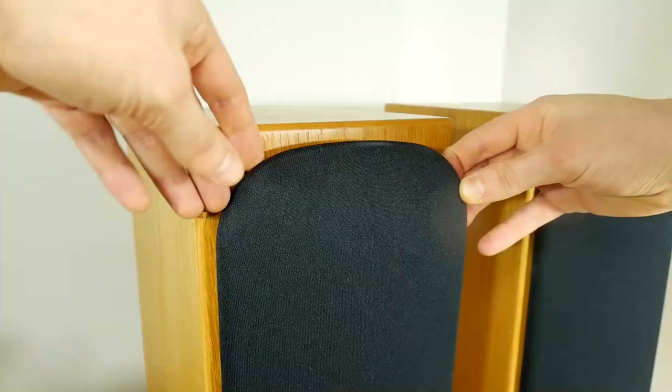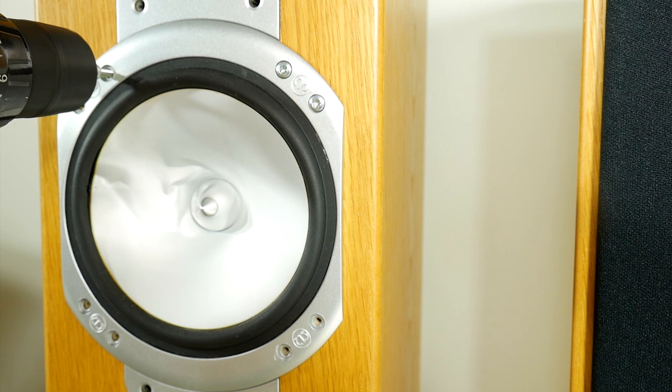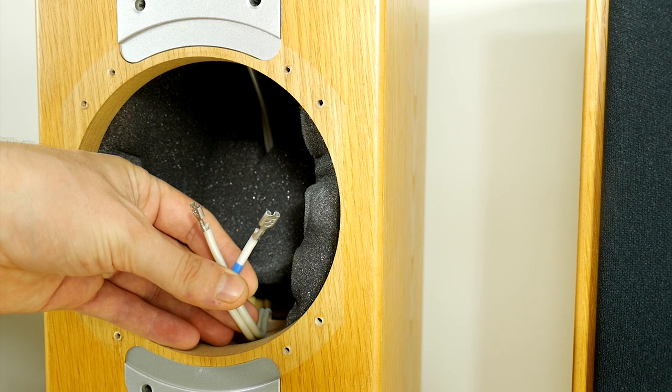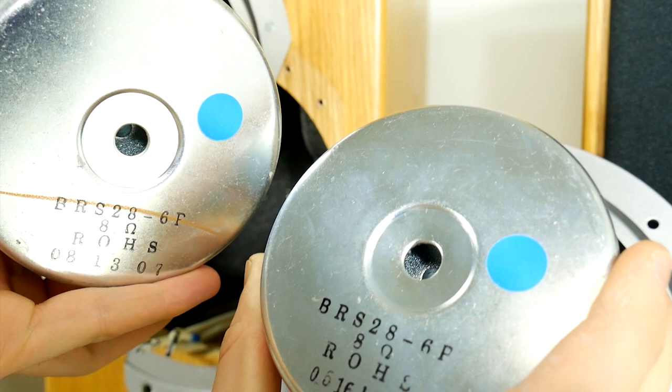We take off the protective nets, and with a screwdriver of appropriate size, loosen all the screws. Don't lose them, because you will need them to screw in the replacement speaker drivers. Carefully take out the speaker, but don't damage the loudspeaker box itself — for example, by scratching. Disconnect the wires; if they're soldered, then unsolder them. It's important to note which contact is for which wire. Usually they're marked, but for safety it's better to write it down to avoid connecting the wire to the opposite terminal.